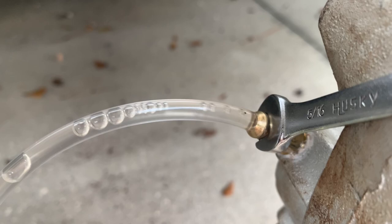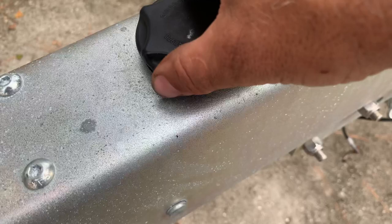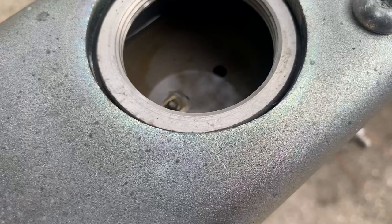Don't forget — don't let your reservoir run out of fluid or you're going to allow air to go into the rest of the system. Make sure it's topped off before you put your trailer back on the road so you'll have plenty of fluid in there and your brakes work properly. Hopefully that'll help you bleed your brakes on your Tie-Down trailers.